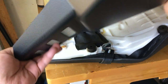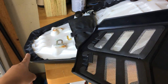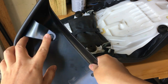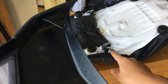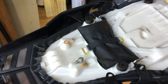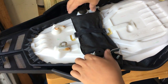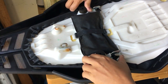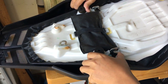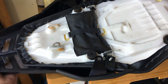Here's the seat cowl. The way this thing fits over the seat cover is that there are two tabs that connect to the back, and then there are two mounting brackets that are supposed to go over the studs. The first pieces we're going to hit are these bump stops right here. Just lift it and slide it in gently. Don't try to force it because you don't want to snap these tabs — once you do, it's game over.